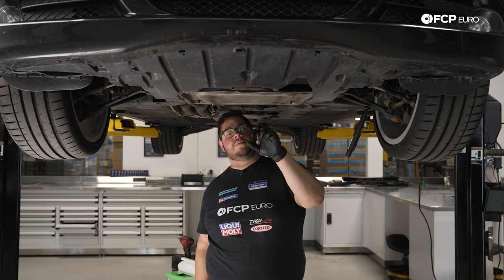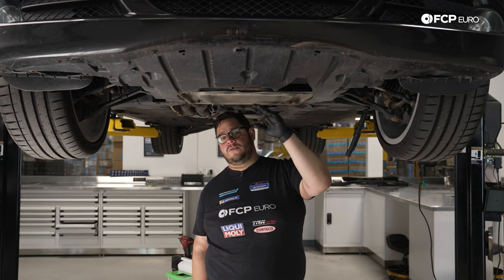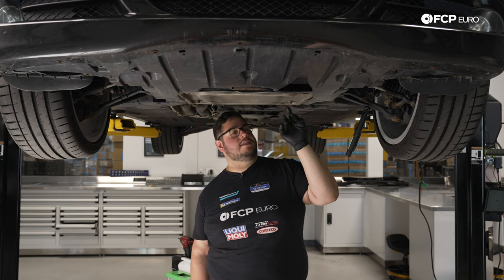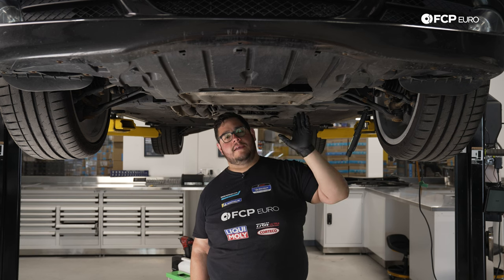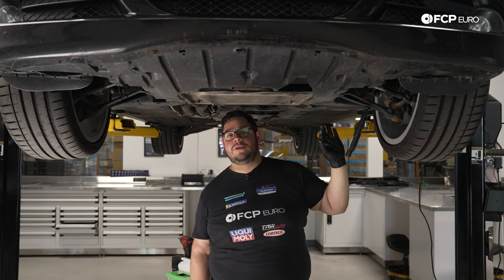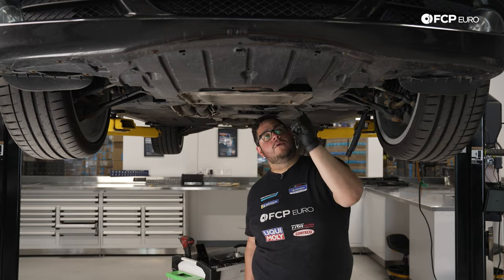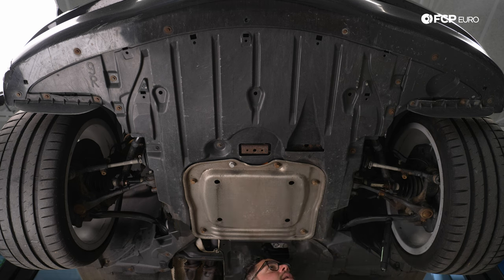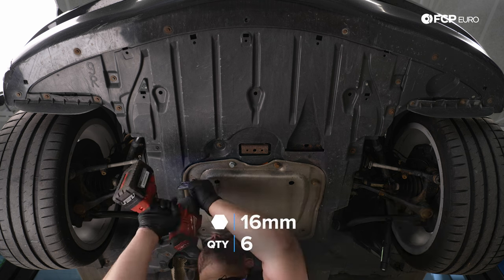Next on the list is going to be to remove the stiffening plate. Just a quick note, I'm sure you are aware of this, but never set your car back down on the ground without this plate. It'll shuffle everything apart, and BMW says do not do that. So we will not do it. These are one-time use bolts. Again, these are linked in the description below. We also talked about them at the beginning of the video, so we will not be reusing these.